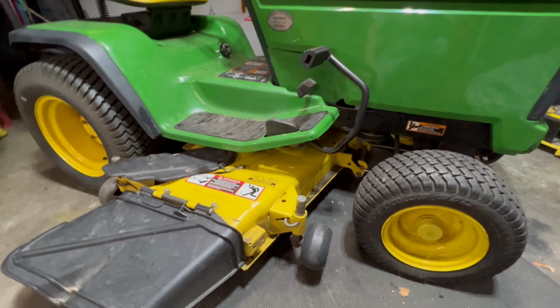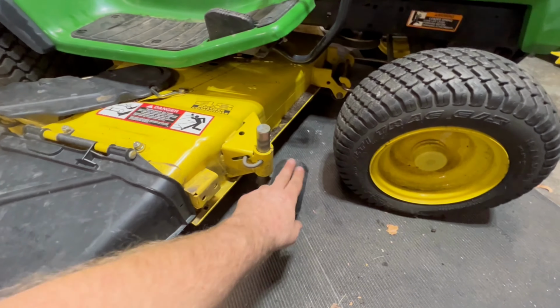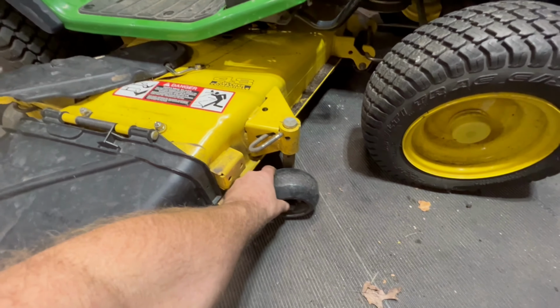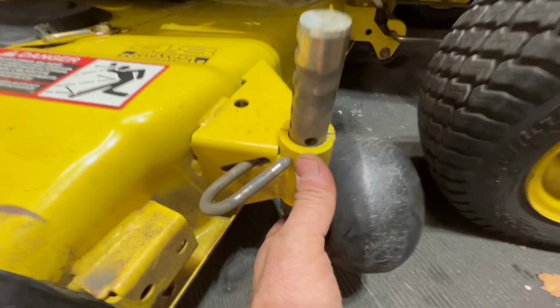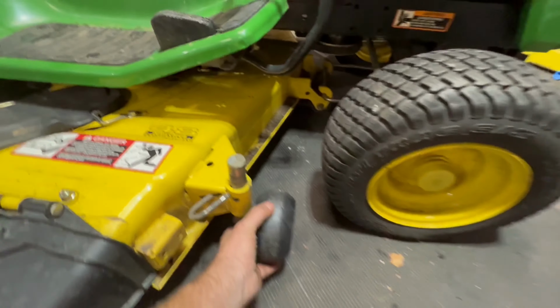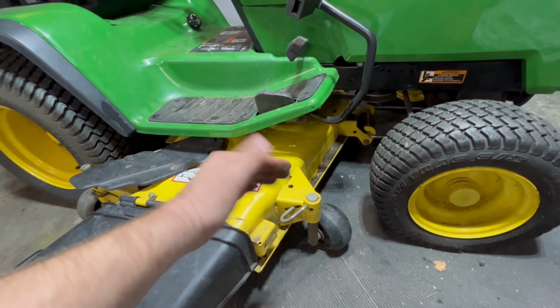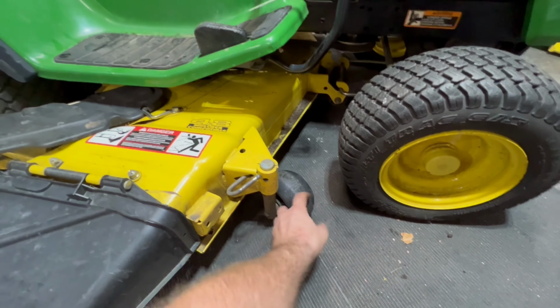So the first thing you're going to do is go around to all your deck wheels, casters. You probably always see them like this. Well, that's because there's a whole bunch of holes here lined for it. But if you actually look, there's one oddball hole right there. See the oddball one? That one you line up, so you can slide your deck in and out on wheels. Otherwise, you're fighting against the wheels, obviously. So turn all your casters this way.